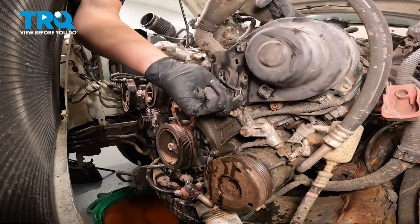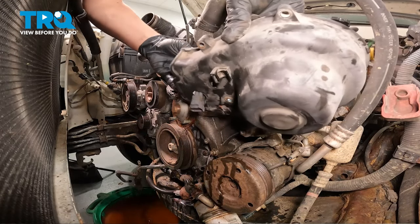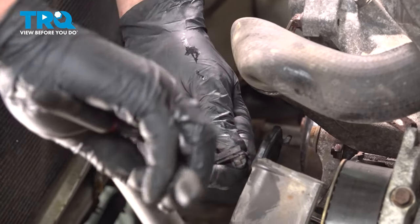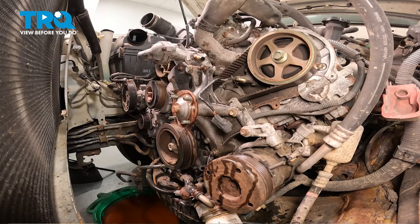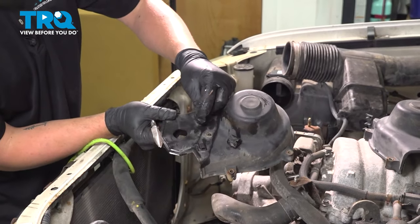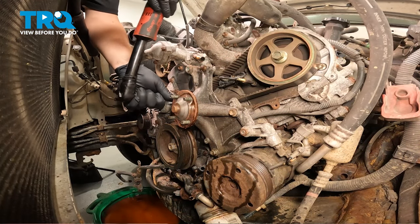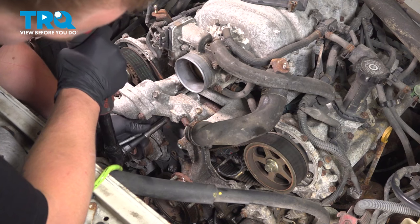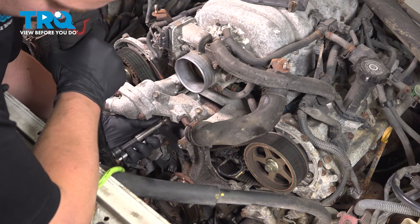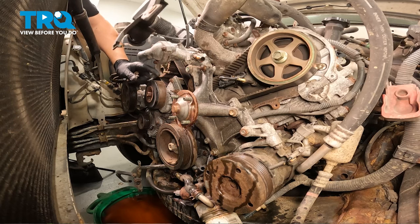Squeeze the pin and pinch the clamp to release the bracket on the front side for the sensor. Remove the harness out of the front clip. Remove the grommet, then pull the cover out. Remove the little sensor clip and push the sensor connector through — you can reinstall this into here if you removed it. Using a 12mm socket, remove the two bolts for the middle timing belt cover and pull the cover off.